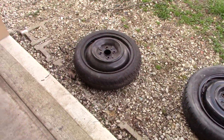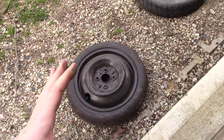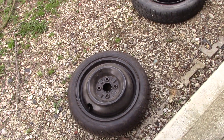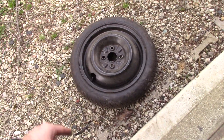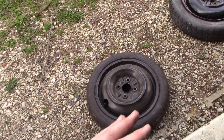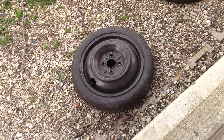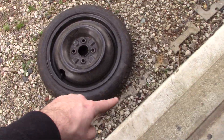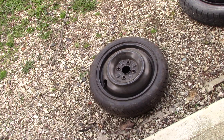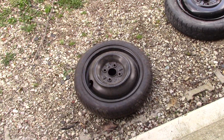That is how you can convert any donut tire to put on any car you want. Say you only want to run 13-inch and 14-inch donut tires on all of your derby cars — go to the junkyard, go anywhere that's got a bunch of donut tires running around. They don't even have to hold air. I prefer to have ones with tires already on them to save me the hassle. You can go and buy 10 or 15 of these 14-inch donut tires off any cars you want. As long as they're all 14-inch rims, bring them all back. Now you have a stack of 14s with tires that are already on them, aired up, ready to go. And whenever you want to put a 14 on one of your cars, take the original donut tire, cut that centerpiece out and put it on a 14-inch donut.